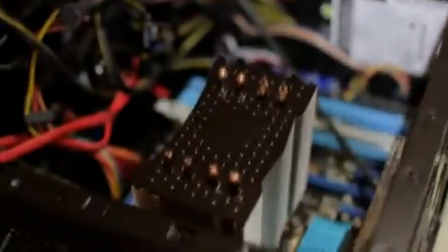In this case the Corsair logo is inside, so we want air to flow in that direction. We're not going to put the fans on until after we mount the heat sink, but that's the direction you'd want to install them. I decided to mount it in this configuration — the arrow points where air will exit, and this fan vents the air out, while the other pulls air in from this direction. It's going to be a tight fit, and if you ever need to add more RAM, you'll have to remove the fans, but that shouldn't be a problem. Once I've done a dry run, I'll get ready to prep the thermal paste.